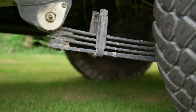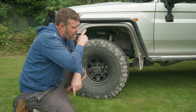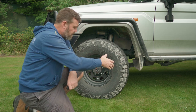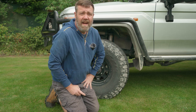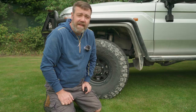When I got the service body, I upgraded the parabolic leaves from 300–500 kg constant load to 500–700 kg constant load. I've also installed Trundle's heavy-duty caster-corrected radius arms, which are longer and push the front axle back into the standard position. The radius arms helped a lot with fitting the 35-inch tires — no more rubbing at the guard. I also installed an adjustable panhard rod and extended bump stops throughout. At the back, I replaced the rear diff housing with a D-WIS housing, widening the rear track and fixing the major track width issue with the 79s.